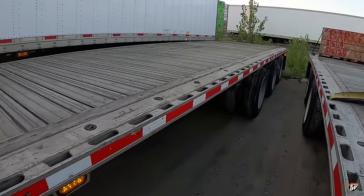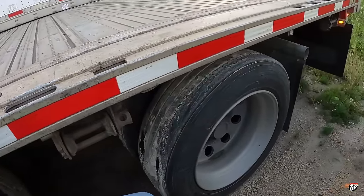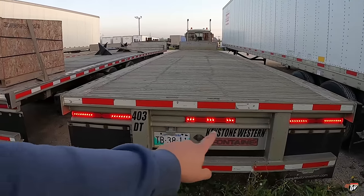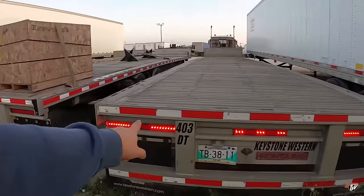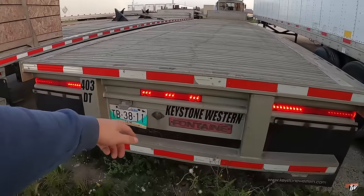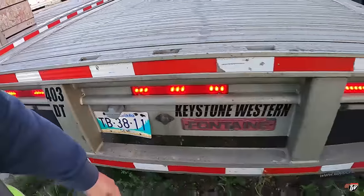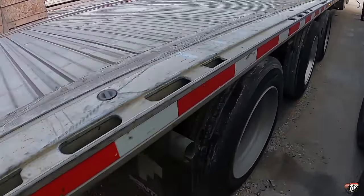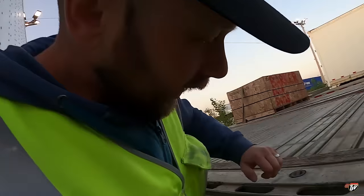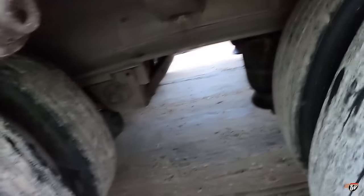By having that handbrake spiked for the trailer, it also turns on the brake lights. Just going back here, making sure all the tires are filled with air, that we have no flats. When you come to the back of your trailer you can check and make sure your brake lights are working and your hazards are on, make sure your signals are working on both sides. When the signal turns off you can see that the tail lights are working as well. Three center lights are working. Just quickly make sure that the license plate light's working. That makes it a lot easier when you don't have to go back and forth all the time. You can also check back here to make sure there's no leaks on the brakes. Trailer bags are filling with air. All the lights are working on this trailer, the brakes, airlines — everything's good to go.